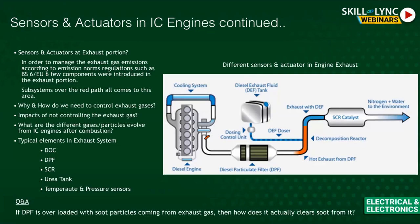When exhaust gas passes through, a small amount of AdBlue is injected via the DEF doser into the exhaust stream. The exhaust contains dangerous nitrogen-oxygen components (NOx). When NO (nitrogen monoxide) mixes with NH3 (from the urea), since both contain nitrogen, a chemical reaction occurs producing N2.